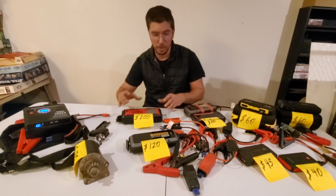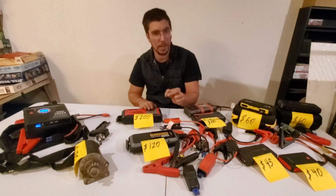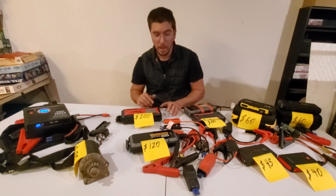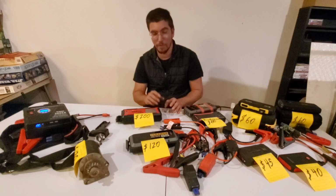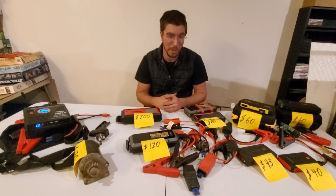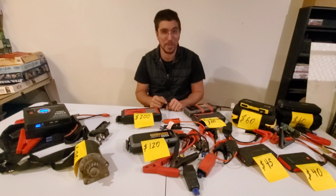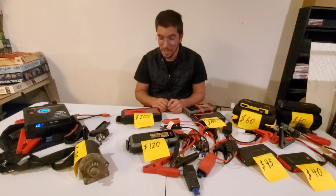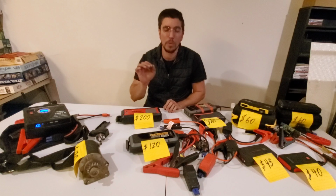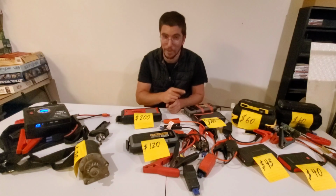Now, while we're here and talking chargers, I want to point out something. These two right here, they come with gargantuan USB-C chargers. And there is a written disclaimer in both of these in their directions of only using the charger for speed charging these units. I thought I'd be a really smart person and I hooked up my GoPro to one and I managed to fry a nice brand spanking new GoPro battery doing it. And I'm lucky I didn't kill my GoPro considering it was boiling hot when I happened to notice it. So, if you get one of these units or any other unit that has a dedicated speed charger, do not ever plug that charger into anything else. I don't care how smart you think you are, it is a bad idea. I already found that out.